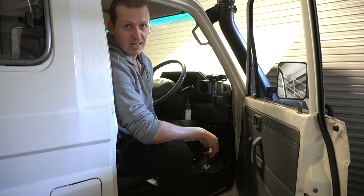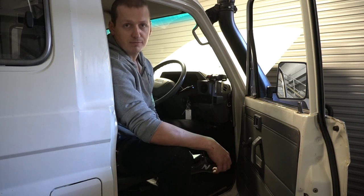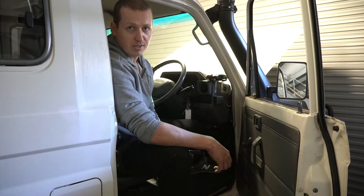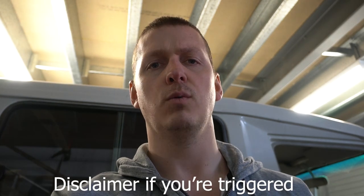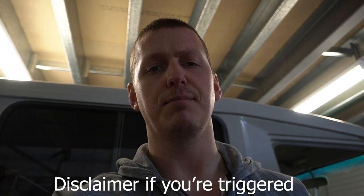You can tell because of the ominous clicks. This is just a simpler version of a voltage-sensitive relay. When the engine's running, the second battery is charging directly from the alternator. It also means that both batteries are bridged during startup, so you can use the secondary battery to jump the primary battery if it runs flat. This is a wild generalization — we're not talking about DC-DC or smart alternators for now. Let's keep it relatively simple.